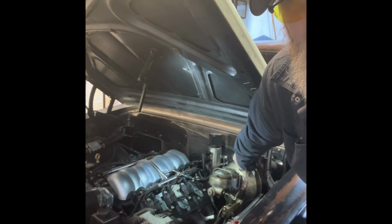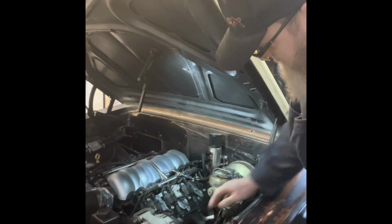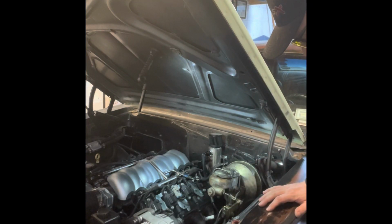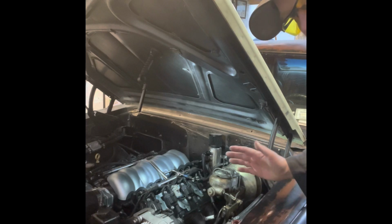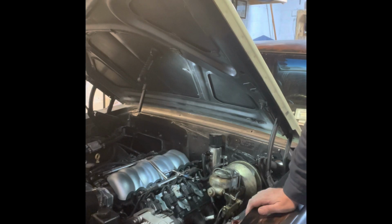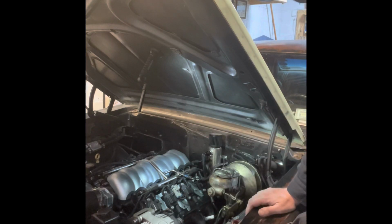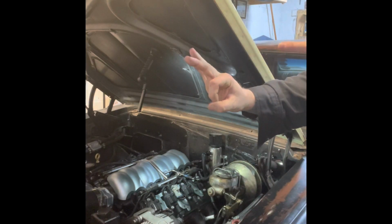So I'm just going to try to quickly pull this thing off, if possible, without breaking any lines. Just yank the bolt here and the bolt here and sort of move it forward. The distribution block is mounted in there as well. These are steel rather than NiCopp brake lines, so I'm hoping they'll be rigid enough to hold it in place, have a bit of give, and I can then put a caliper, a measuring device, on the back, and measure the diameter of the bore, and then do a depth check. Bore depth check for the rod.